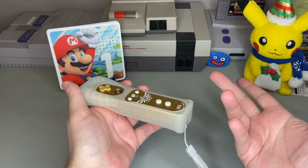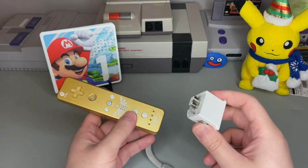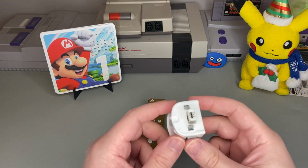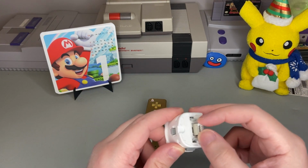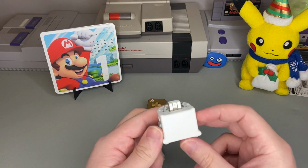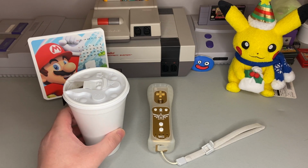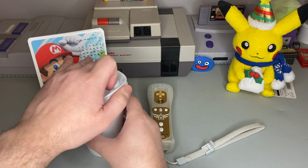probably because it was very technically complicated. After this came a problem where the connector to the Wii Remote and the hooks that held the Wii MotionPlus in place would break during harsh movement. This was fixed by making the connector a bit more free-moving and changing the hooks to a sturdier type of plastic. The last and most interesting problem, in my opinion, was that the casing around the gyro sensor would absorb